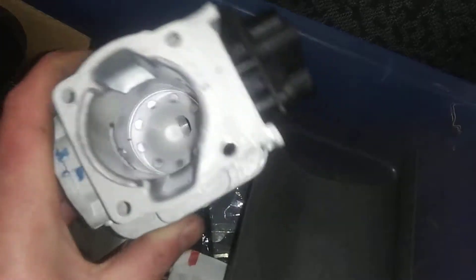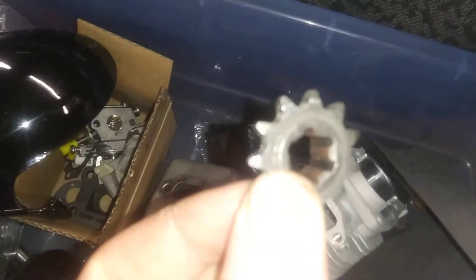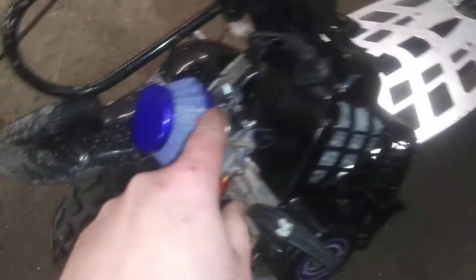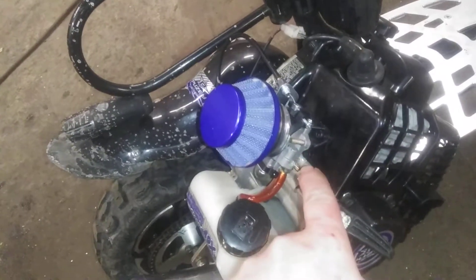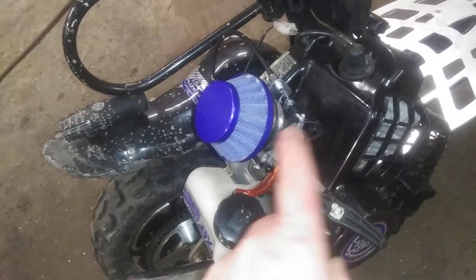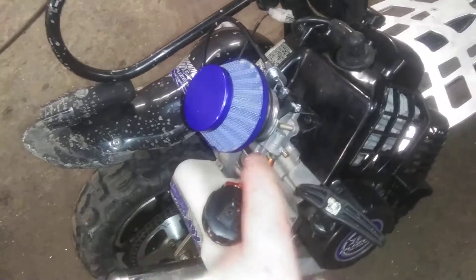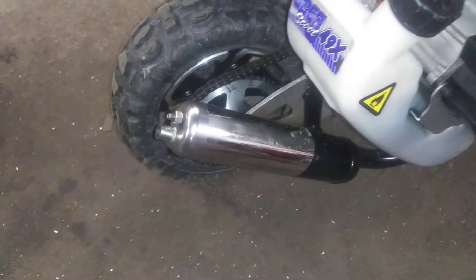I know this isn't an Uber scooter head, but it'll work if I ever need it. I went from an 11 tooth sprocket up to a 14 tooth sprocket. After I ported it, I took the 10 millimeter carburetor off, put a 15 millimeter velocity stack, air filter, and bicycle exhaust.